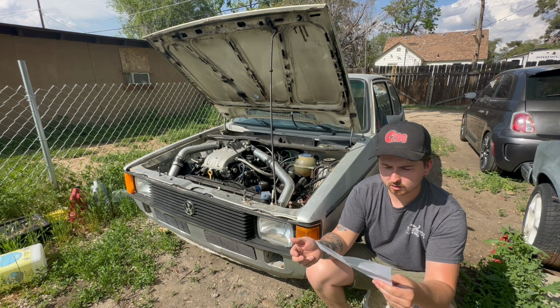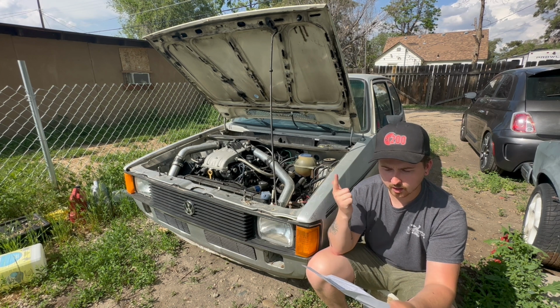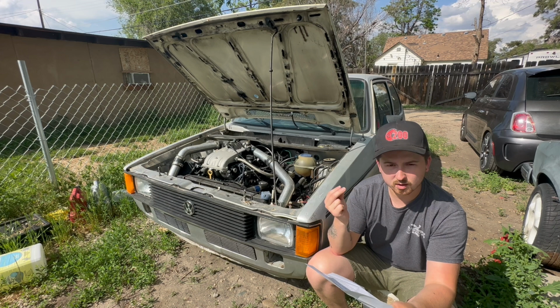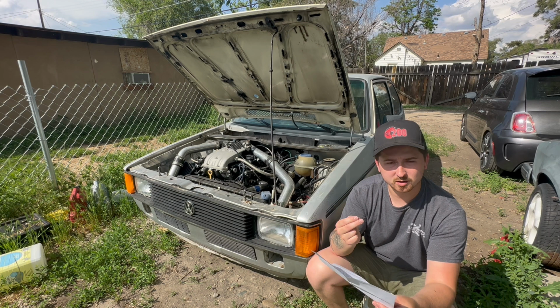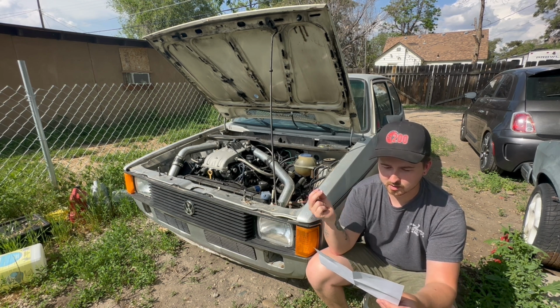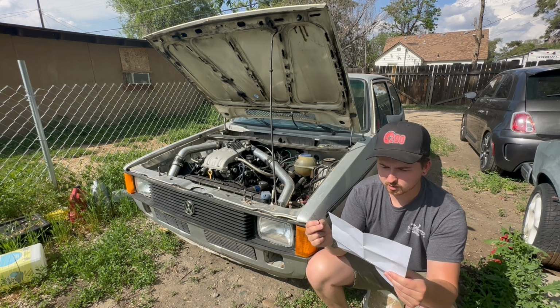So for the kit, to replace the belt, which I would do, the tensioner, and the water pump. Those are 3 things that are major if you plan on driving this car for a long time. And don't get the tensioner and skip out on the timing belt, because then it would be all for nothing. The motor will probably blow up.